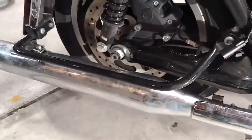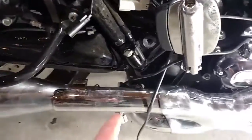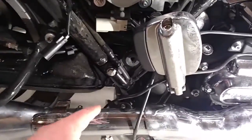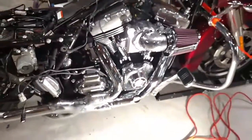I've got the muffler just slipped into place, ready to be tightened down. And then the crossover I've got to get tightened down, and then the muffler on the other side aligned and those tightened down as well. Then we just need to route the O2 sensors back to their home destination and keep those clips in a safe way.